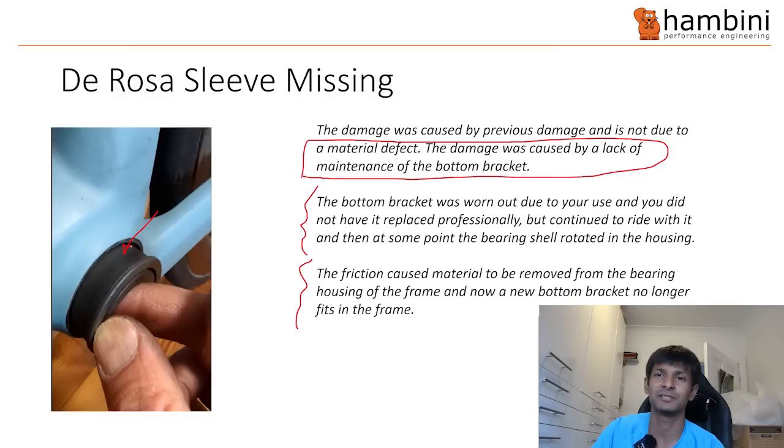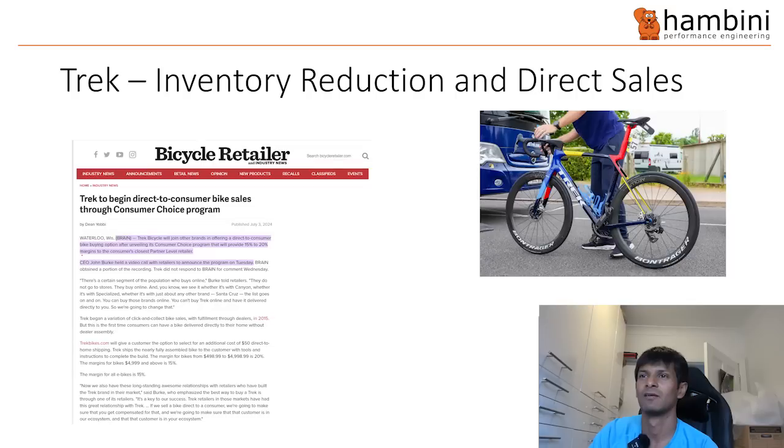So we've got a Shimano bottom bracket in there that's made of plastic, let's say it's nylon, and a rock hard carbon frame, and they expect the nylon to wear a perfectly cylindrical hole into the carbon frame. I mean, who are they kidding? They're coming on this show and then making themselves look like absolute muppets. So there you go. If you've got any more of this kind of thing for me to ream, remember to send it in.